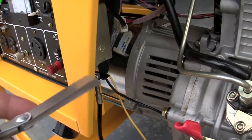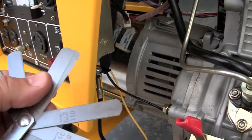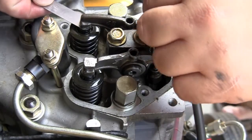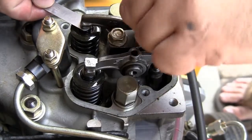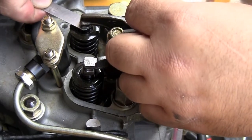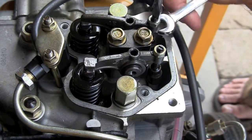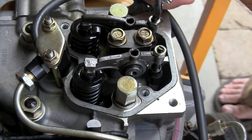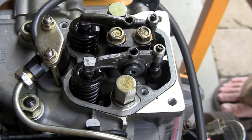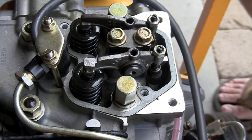Check your engine manual and look at what the gap should be. Grab a feeler gauge — you can buy it at any automotive store or NAPA. The intake is the first one. It should be adjusted — here I'm using the wrong size, it shows 0.11 mm, but it should be 0.15 mm. I can adjust the screw until it's just snug, just making contact, rubbing a little bit. Hold it in place with a flathead screwdriver and lock it into position. I will just confirm again that it is at 0.15 mm, not 0.11 mm like my feeler gauge is showing in this video.